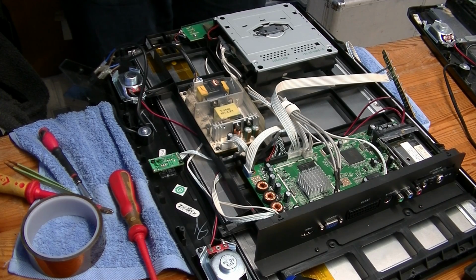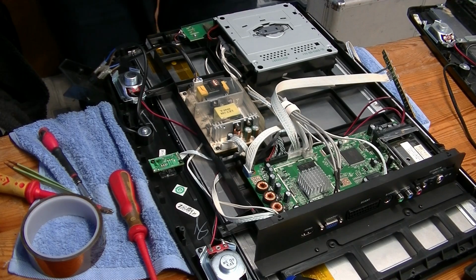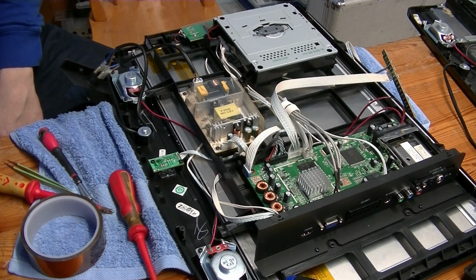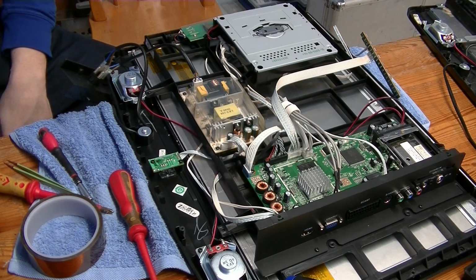So obviously when that cable went, it took the tube with it. So yeah, it's not really worth doing much to this. I mean, you can get LED conversion kits for them. So I'll have a look on eBay and I can get the LEDs, which are 490mm, so there's two of them, one goes here and one goes here, and then you get a converter board which enables you to adjust your brightness.